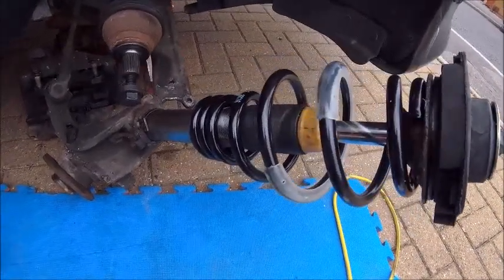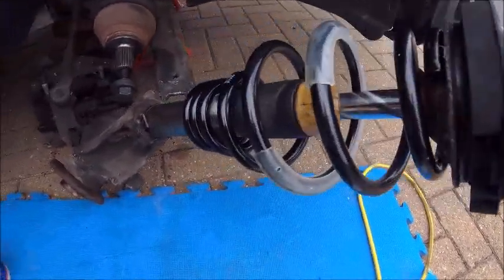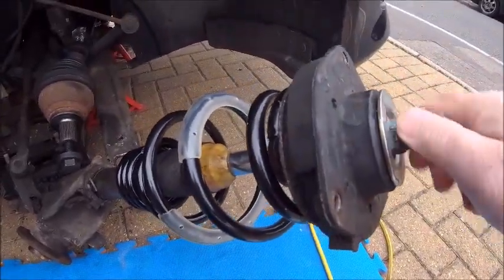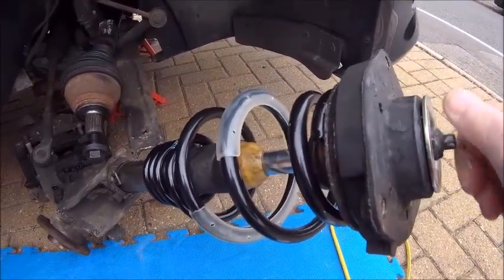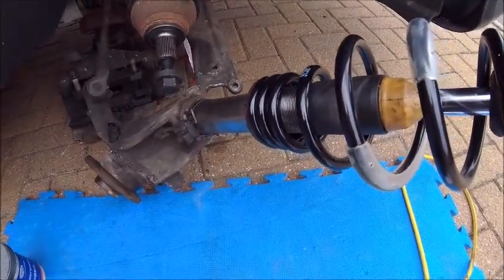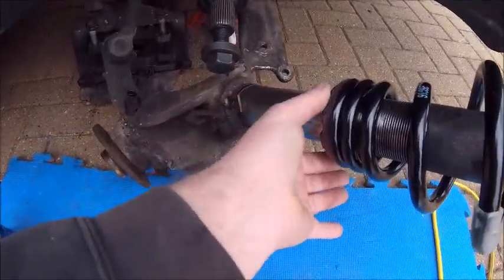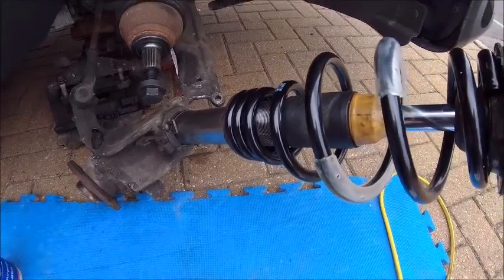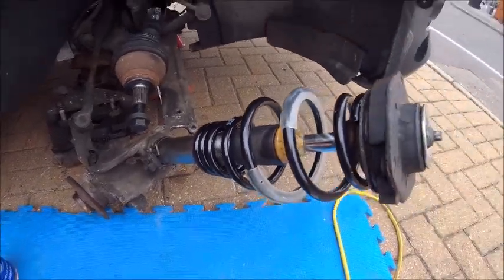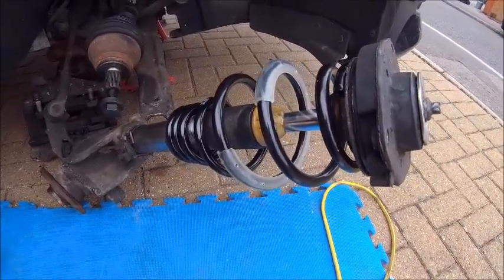As I've mentioned before, the great thing about coilovers is you can take the preload off them, so you don't need spring compressors or anything crazy like that. You just basically put the spring on, put the top on, bang your nut on, and then take the preload up to roughly where you think it's going to be. I counted the number of twists on this so I'm going to set it about the same as it was - they're new springs so they'll probably need some adjustment anyway.